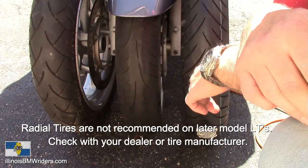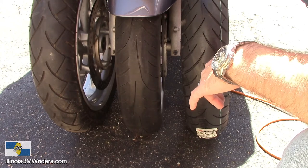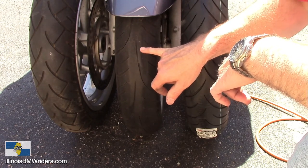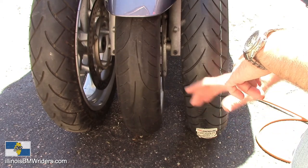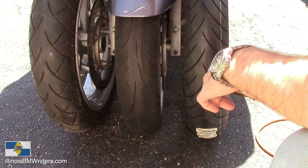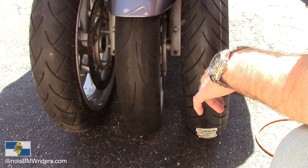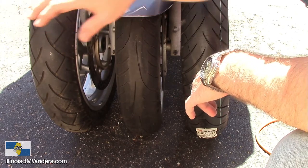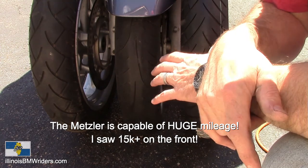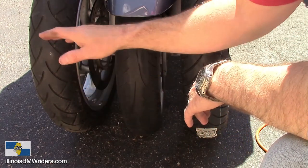Now I'm going to show you all three types of front tires. This is the Metzler 880 front tire, the one in the middle is the Storm 3D XM front, and this one over here is the Storm 2. You can see the tread patterns are very different. The Metzler front tire is similar to what I said about the rear — it's a very hard rubber compound, very predictable handling, rolls easily side to side for steering on dry pavement. It's a fantastic option on dry, but in the rain it's going to fall short and you might wind up activating your ABS more.